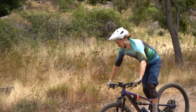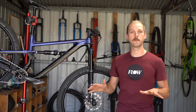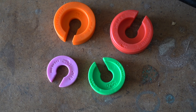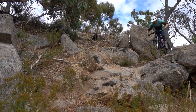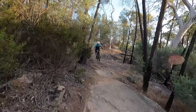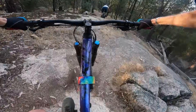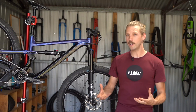As for the rear suspension, it ramps up nicely right at the end of the travel, giving good bottom-out support for big hits and harsh landings. While the stock setup worked for me and I never hit full bottom-out once, it is possible to add bigger volume spacers inside the shock to give more support through the latter half of the travel. Overall, the single-pivot suspension design works really well, though there is a touch more feedback through the pedals compared to some of the more refined 4-bar and multi-linked designs I've ridden lately. If you are smashing into big stuff repeatedly, the rear shock can occasionally struggle to recover in time. A bigger volume spacer inside the rear shock will give you more deep-stroke support, and it's also worth mentioning that the Siskiu T-frame is coil shock compatible, and you could also fit a longer 150mm travel fork on the front.